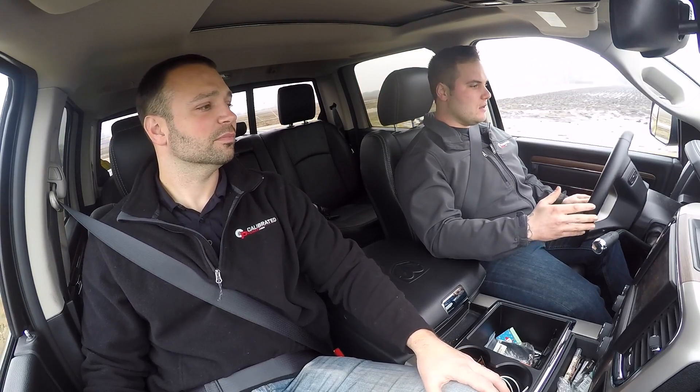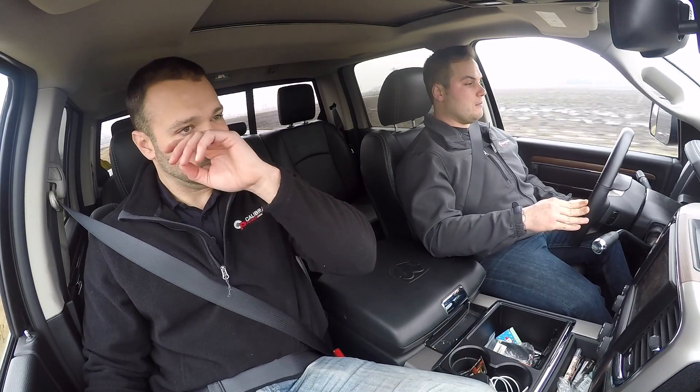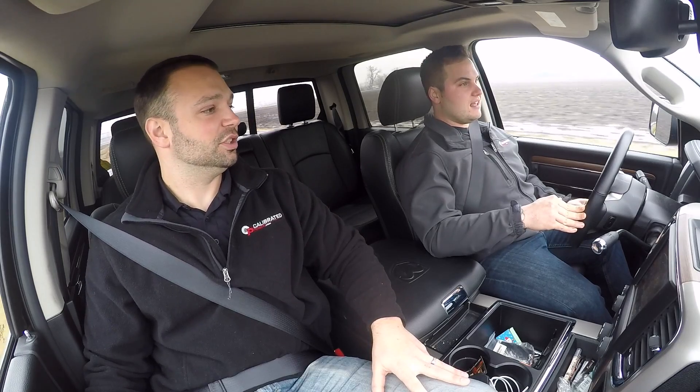What I really have to note is the transmission shifting. These trucks — talking to guys on the phone, my own experience — I'm doing 35 miles an hour right now. The truck would have already been in sixth gear, converter locked up. It would have been lugging. They have a tendency to lug, to shift early, and especially on stock power when you don't have the torque there to pull the truck. That's a problem.